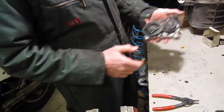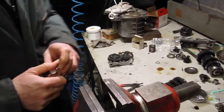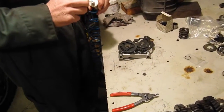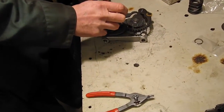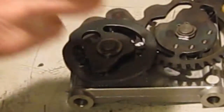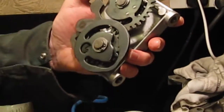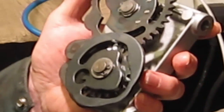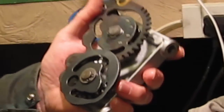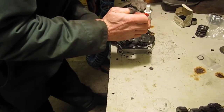I'm going to put it in first gear. To show you an easy way to get the assembly back together, I use a bit of Tipp-Ex — I just put a dot on one of the teeth there as an indexing mark, and a corresponding mark on the other part, so that when we go to put it back together we know that tooth has to go into that slot to get the indexing correct. You can't really get it wrong, but if you're doing this for the first time, it helps to have reference marks. Having done that, we'll just remove the circlip.